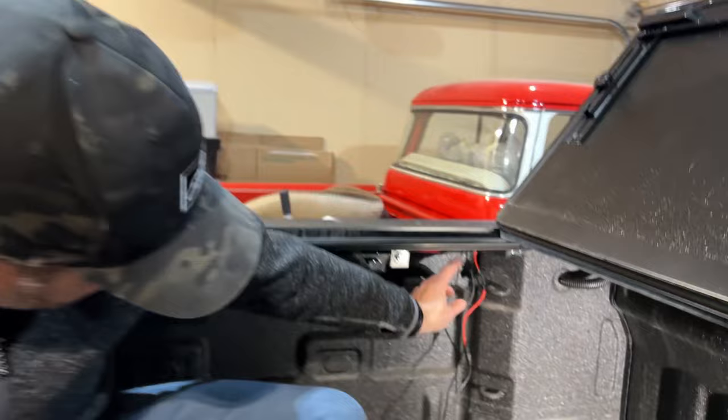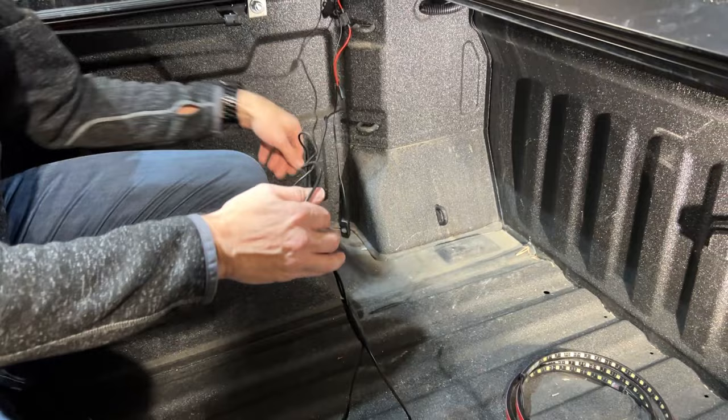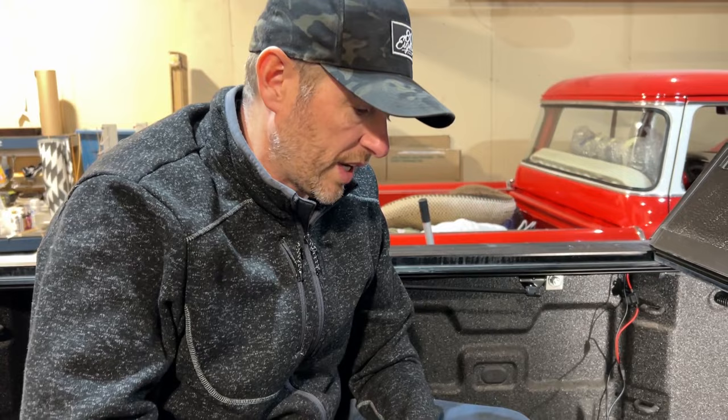We got all our soldering done. Our relay is tucked up here and out of the way — it can't get wet because the rail is completely covering it. Our switch is in the on position. I'm going to hit the unlock button, which will allow all my cargo lights to turn on including these. Most people don't have it on the unlock button, but I do because of a different mod I did in another video. So when I hit unlock, these should all come on along with the cargo lights. You can see all my extra lighting that's on. Now let's try the cargo light switch and see if they come on that way too.